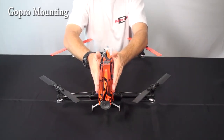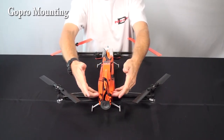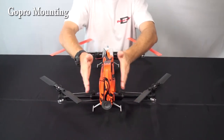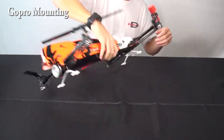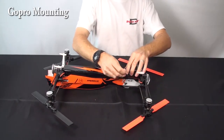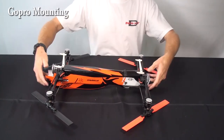Make sure the rear fuel line is pushed down all the way so the canopy can't move side to side. It has little plastic tabs on the inside where the canopy mounts — the canopy needs to be pushed up all the way against those tabs and the fuel line pushed against that. This keeps it from freely moving but still allows it to flex, which we want. Also make sure to use the Velcro strap as explained in the instructions, pulling it down tight so it doesn't tend to move and flex freely.